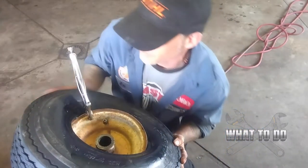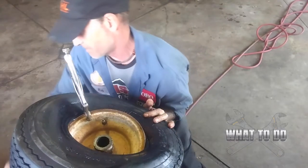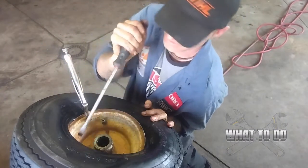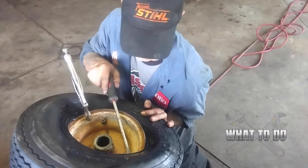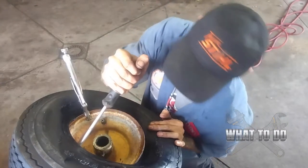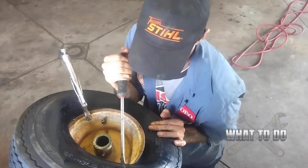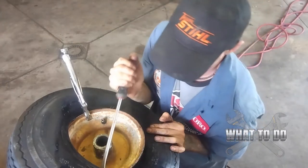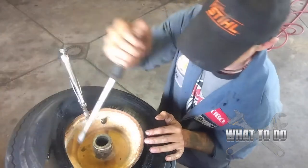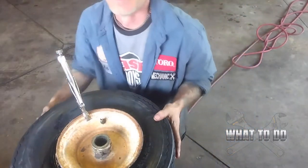While you're holding it, keep this tire pushed in against the rim. Don't try to take one big bite out of this — this is where you fail. Come back here and take little tiny bites on the tire. If you try to take one big bite, this is where people break beads and stuff like that. Not even halfway — go up and do it an inch at a time. I'm telling you, it took me forever to learn this. Inch at a time, constantly keeping pressure against the rim — and there it is, it's on.